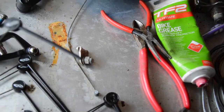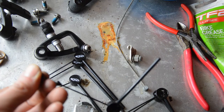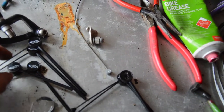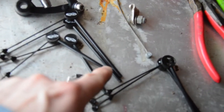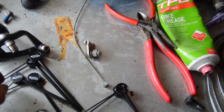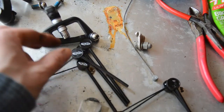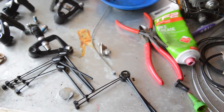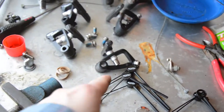So what they've done now is introduce this device - a pretty solid bridge. The cable, instead of connecting at the hook, runs through and down one arm and connects directly to one arm of the cantilever. If it does fail, it just stays in one place and doesn't drop onto the tyre. Seems a better idea to me because I don't want to go over the handlebars. So I'm going to clean everything up, grease it, and start bolting on the new arms.